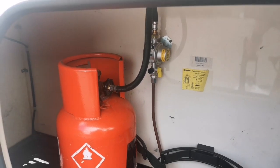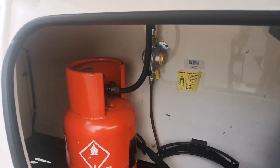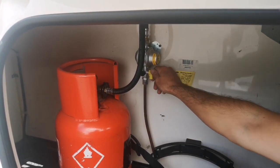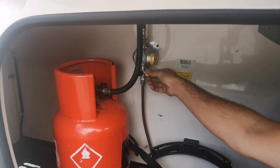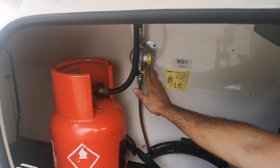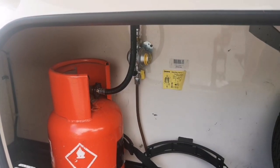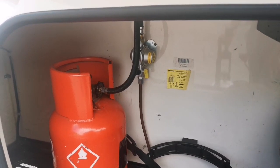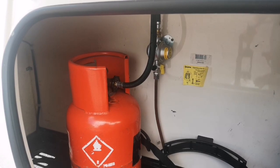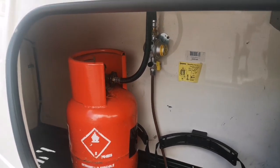The leg winder you'll find in the front locker box here, and you've also got an alloy wheel spare just in case. There is a little yellow shut-off valve on the regulator - that's really just for servicing. What you should do is leave that valve alone and just turn your gas on and off on the gas bottle itself. If you're not going to use the caravan - putting it into storage, taking it home, etc. - before you travel, make sure that gas bottle is off. We've got straps here to lock them into position.